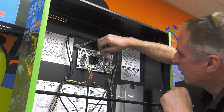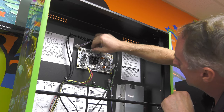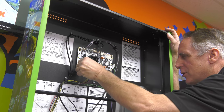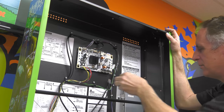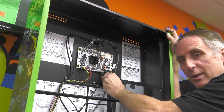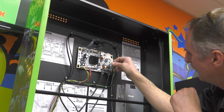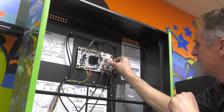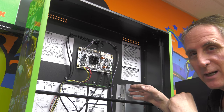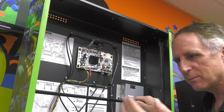I'm just going to go back in reverse order here. Whenever I do this on monitors, I'll have a verbal checklist where I check everything off as I go so I don't forget any connectors. Especially on the old Williams machines like the '89 series — there are so many connectors on the power driver board. I don't know how many times I've plugged the whole board in and missed one connector, and suddenly some solenoids aren't working, some lights aren't working.